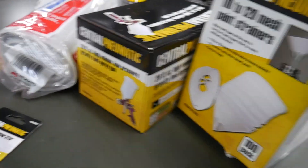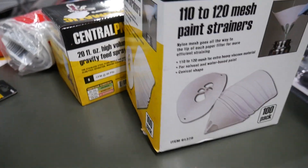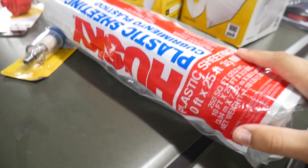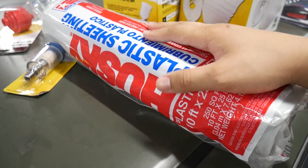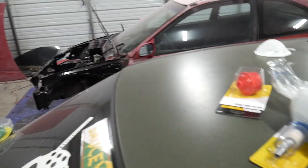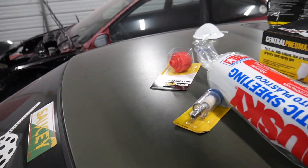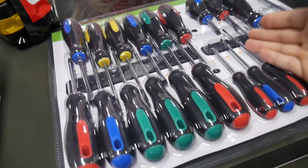I got a whole box of 110 and 120 mesh paint strainers for about five bucks, and I got a roll of plastic sheeting. I'm not sure if I can use it for the windows - if I can't, I'll go back and get paper. I know this stuff folds out really well so I'm gonna put it over the engine bay and cover that up, as well as the tires. I may end up laying some all around under the car to minimize overspray.